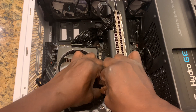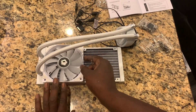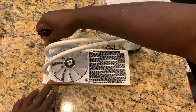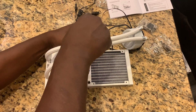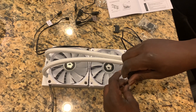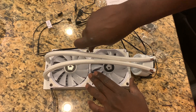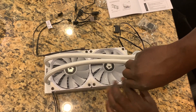Now that we've got the AMD Wraith cooler uninstalled, our next job is to assemble the fans onto the radiator — which wasn't hard at all. Just take those extra-long screws and screw them into each of the four contact points, then repeat for the second fan. My mistake was not putting both fan cords on the same side. I ended up having to jury-rig the cords and take it back apart. So be careful — put the cords from each fan on the same side so you don't have any problems connecting them.